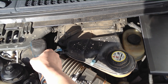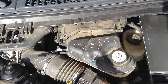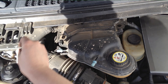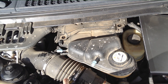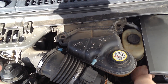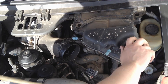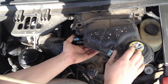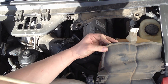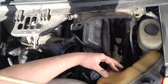Pull the 8mm over here for the clamp — it's a little too loose — and then we're going to get the mass air here. We're going to loosen these, take them out, and put those to the side. That'll allow us room to get the air cleaner out. Don't forget your air minder. Then we can get this whole assembly out of here in one piece. Make sure those ports are sealed, and pull it down and out and set it upright off to the side.